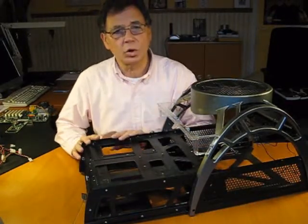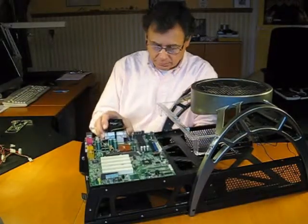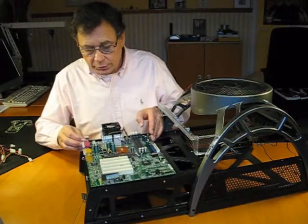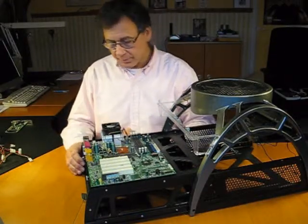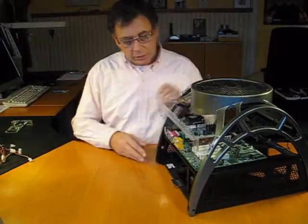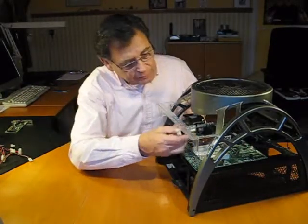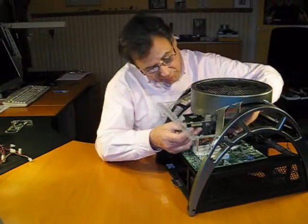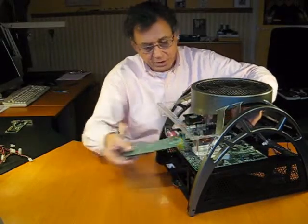As you can see, I can slide out the whole part on which the motherboard will fit — like this — which has to be screwed down to the supports. And once you have put on your stuff, your memory sticks, etc., you can slide it back. And that's the only time when you can actually put on your peripherals, which is a little bit fiddly to get in here because your hands really don't fit very well inside this case. But you can fit them in here.